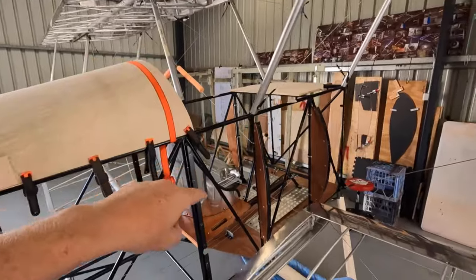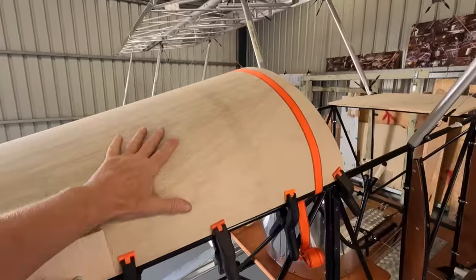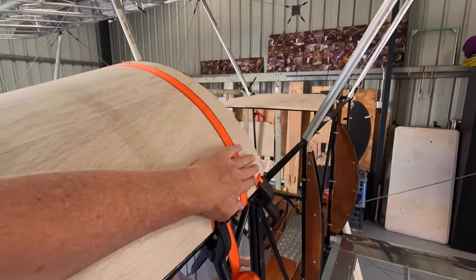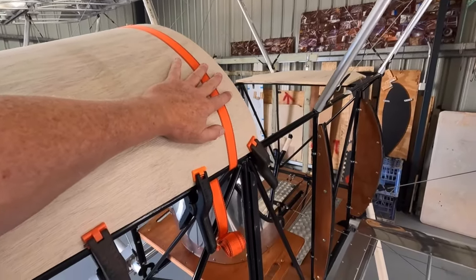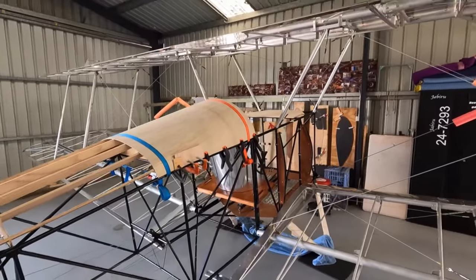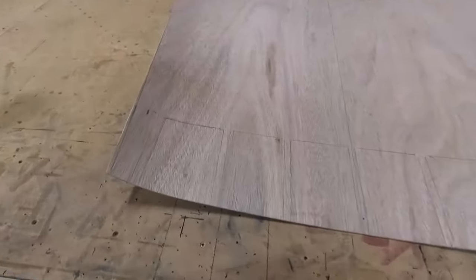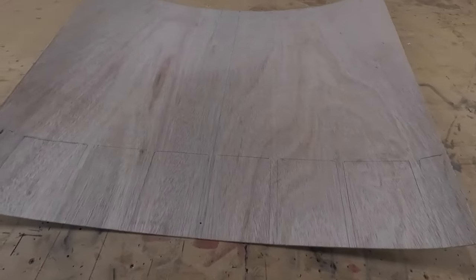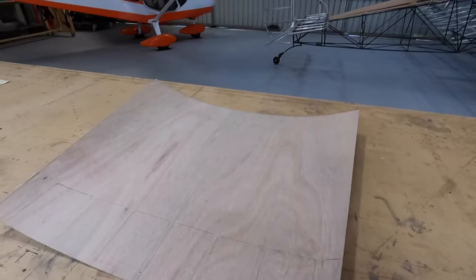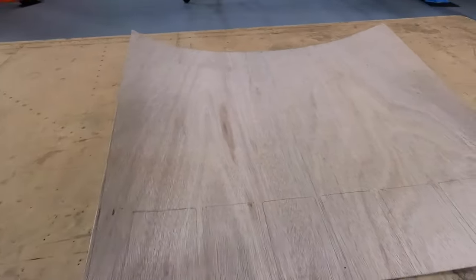Once the seat belt's in and positioned, it's time to hop in to position it, drill the holes, and it may stay in the aircraft. At the same time I'll prep this for gluing, get that glued on, then the side panels can go back on — they overlap the turtle deck just enough to be an embuggerance at this part of the build. Then with the side panels on I can make my wing fairings. So — rough-cutting, well, final cut on this turtle deck. I'll take the time to make the round bits at the back because it's a Camel and it looks nice.